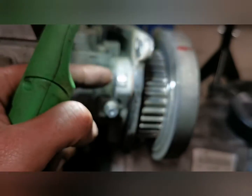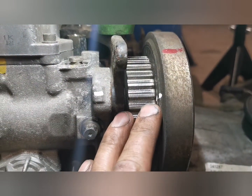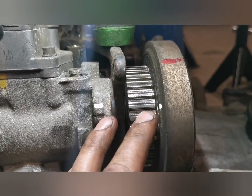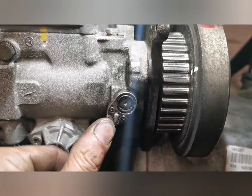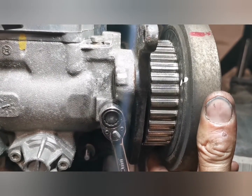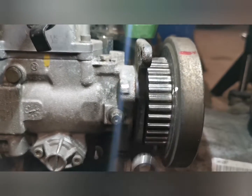You've got this line here and there's a line in the middle. The way this is set now is exactly how I stripped it down and it ran sweet, so this is basically where you want to be aiming for. It's nice and tight now — tightening this basically clamps it. There's no actual slot as such; it just clamps. Undo that and the pump moves, so you want to set that. As soon as you find your TDC mark, lock that straight off before you take the belt off.